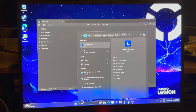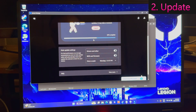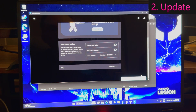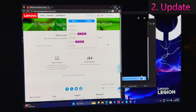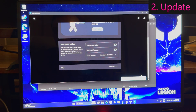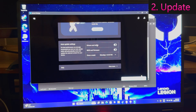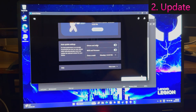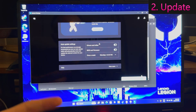BIOS updates - that's another thing here that's very important. So on this Legion that I'm using right now, there's something called Lenovo Vantage. You can go in here and do updates. Other laptop brands will have other things - Asus has MyAsus, HP has HP's service. They all have their own software. You can go in and update your BIOS and hardware drivers. You can also go into the manufacturer's website if you don't want to do it that way. You want to update your BIOS because BIOS is kind of the instructions for your computer to run at baseline, regardless of the operating system. There are potential security risks with older BIOS and they will address those. Also, sometimes there are errors - I've reviewed laptops where the GPU performance was too low, not giving enough power somewhere, fans were weird, whatever. Those BIOS updates will address those issues.